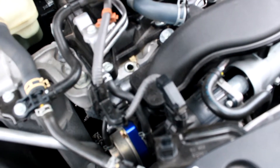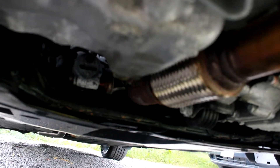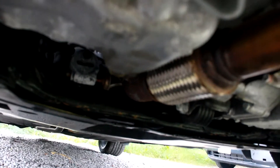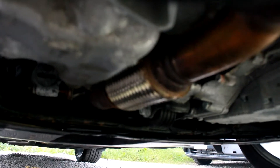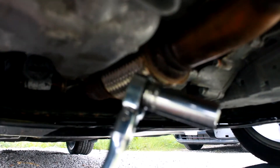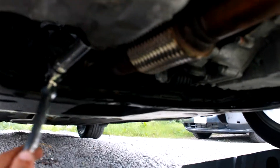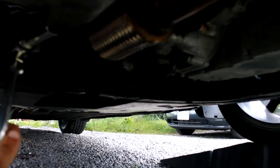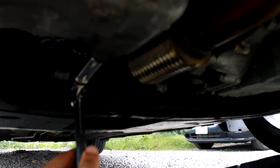I've already got the car jacked up and we'll hit the bottom. Now that the car is all jacked up, underneath the car there's an oil drain plug — you can see it right there at the back of the oil pan. We use a 17 millimeter socket on it, and as you can see it doesn't take much force.